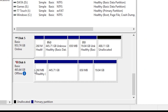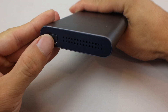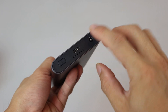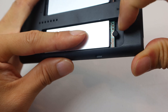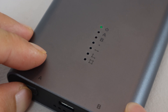If you're wondering what happened to the rest of the capacity of the larger 1TB drive — since we only cloned over 500GB — it's simply unallocated, and it won't be accessible until you allocate it in Disk Management. Overall, this drive enclosure performed exactly as expected. It lets me access two M.2 NVMe SSDs at the same time with decent read and write speeds, while also giving me the ability to clone one drive to the other without needing a computer. I love that this enclosure is completely tool-less, from opening and removing the drive bay to installing the drives — no screwdrivers and no tiny screws to lose. While it's not compatible with SATA M.2 SSDs and does run a little hot to the touch, that's not a problem for drive performance, and even though the cloning process is slow, it eventually gets the job done.